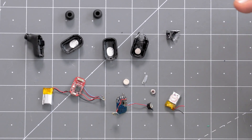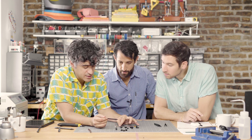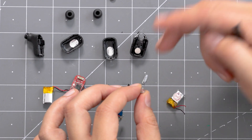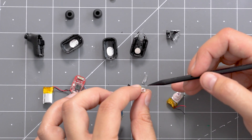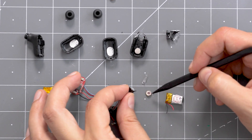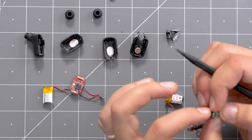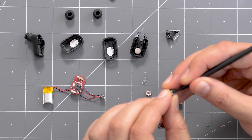How big is that battery? It's 50 milliamp hours — double what you get in the Apple AirPods. And the thing that makes this all what it is is the voice coil, or the speaker — this tiny module right here. As you can see, when that magnet jumps at it, it's got its own neodymium ring around the outside edge. There's an incredibly thin membrane with little pleats in it — that's what vibrates back and forth. Glued to that is a tiny copper coil with two wires coming back to the board. They run current through that copper coil, which causes the membrane to vibrate. There's also a tube in the center, and I don't really know what that does — I would have thought it connects air to the backside to allow a resonant chamber, but there's a stopper here, so not totally sure.